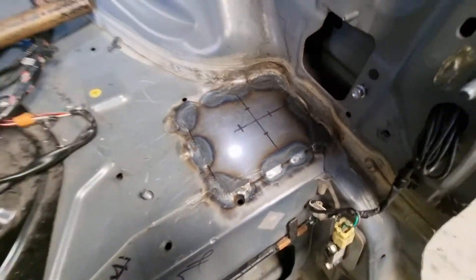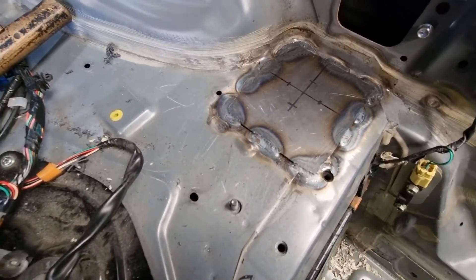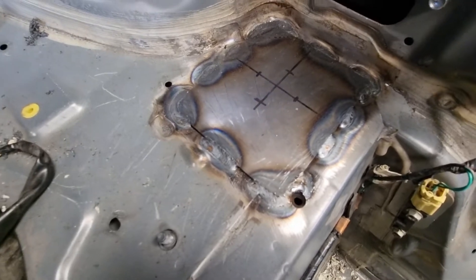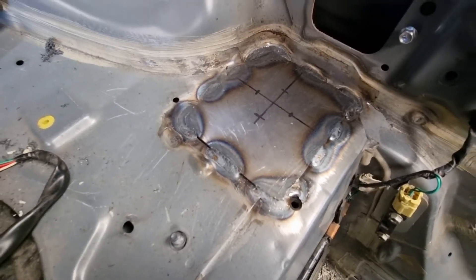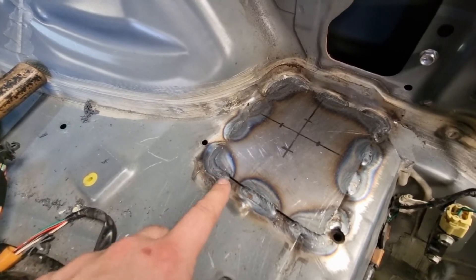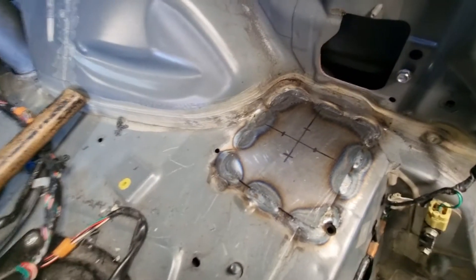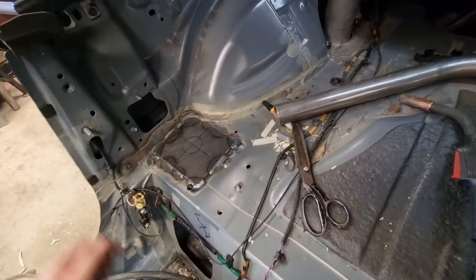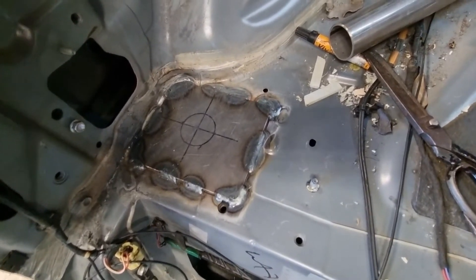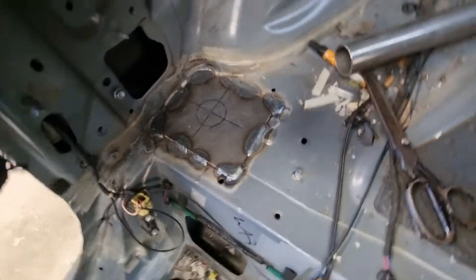This is them welded in — got one to fit nicely to the body. 20mm stitch welding is apparently best for this sort of thing, where you're connecting thicker steel to a thinner steel car body. In a crash, if you fully weld it, it can tend to tear the whole way along the weld. Whereas if it's only stitch welded, it'll tear to the end of the weld where the heat-affected zone is, and then stop tearing — so you should get a stronger connection, even though it's not fully welded. It seems counterintuitive, but it has been tested and that's what's permitted. As far as Motorsport New Zealand is concerned, 20mm stitch welding is the way to go.